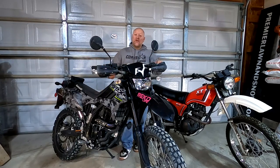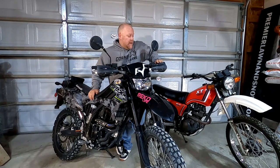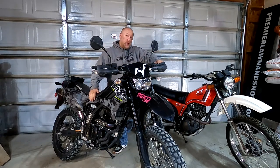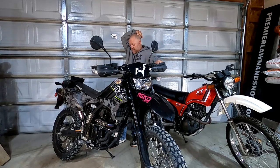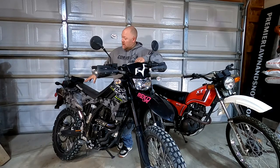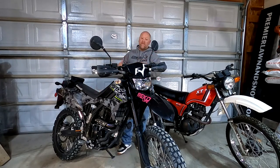A 13-tooth front sprocket is super easy to change and doesn't require you to change your chain. I noticed a slight difference changing the front sprocket but it wasn't as dramatic as some YouTube videos claimed. But as soon as I changed that rear sprocket - stock is 42 in the rear and 14 in the front - I put a 13 on the front and went with a 50-tooth on the rear. I had to order a 520 chain by 110 links, so front sprocket, rear sprocket, and chain - 110 links, perfect fit.